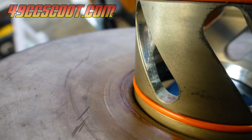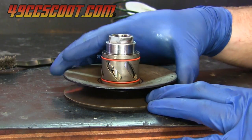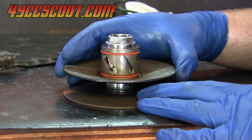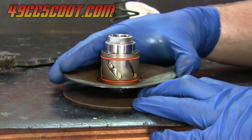I noticed some mild wear inside of the grooves that I was using in the torque driver. I could barely feel a little rough spot around that area when paying close attention while moving the torque driver by hand. I'm not sure that such minor wear would break belts, but it was near the end of the travel, possibly where my belts were breaking at a bit over 40 miles per hour.